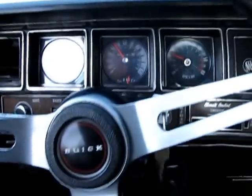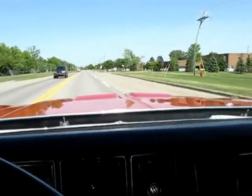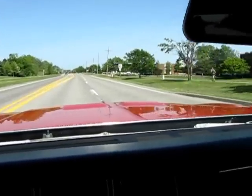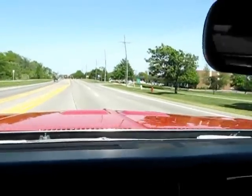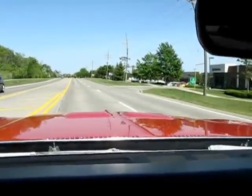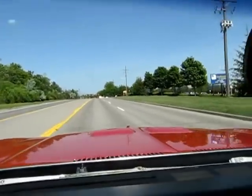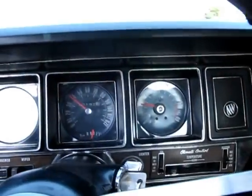The horn does not appear to be working. The wipers are working. The radio's working. Turn signals are flashing both ways. The air conditioning is working, but the high circuit is out, and now the belt's giving us a little smoke at the clutch. That might need service. It's going to likely need service. Tach and speedo are both operating.